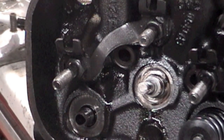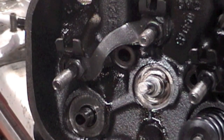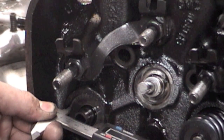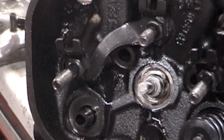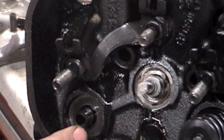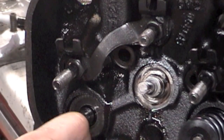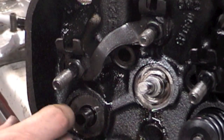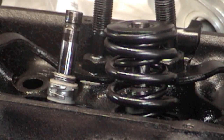Get your notebook and pen and your digital caliper. We're going to measure the diameter of the valve spring pocket — measure it, swing it around a little bit to find the widest points. I got 1.551 inches — write that down. Where your valve spring sits into the pocket, you want about five thousandths (0.005) of clearance. That lets the valve spring move around without binding. If she's too loose, she'll dance around on you.